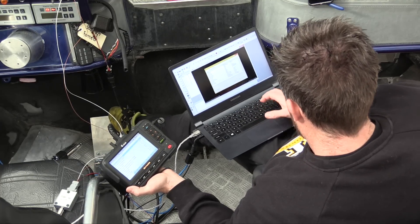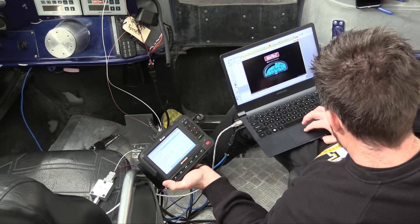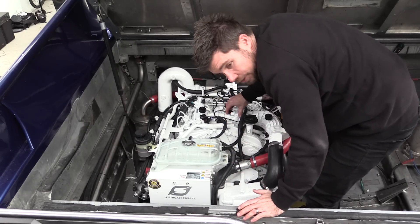This shows us the data as well as what address on the CAN bus the data is being sent at. After that, we still need a way of decoding this information because it is simply a bunch of hexadecimal numbers with very little meaning. The way we do that is by finding out which sensor information is being sent on what address — a simple case of trial and error by unplugging a sensor and seeing what particular piece of information on the CAN bus changes.